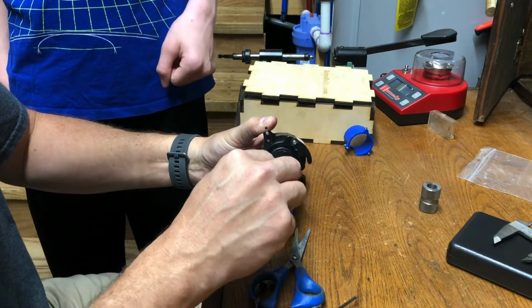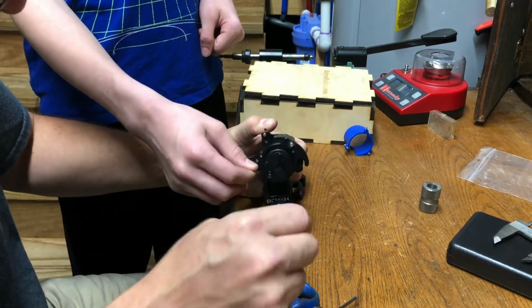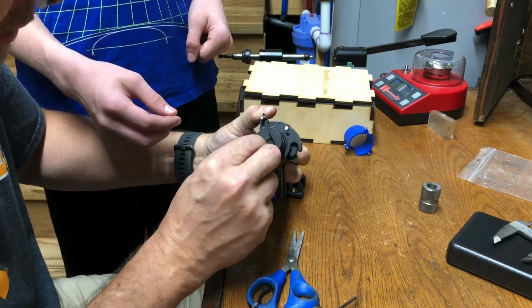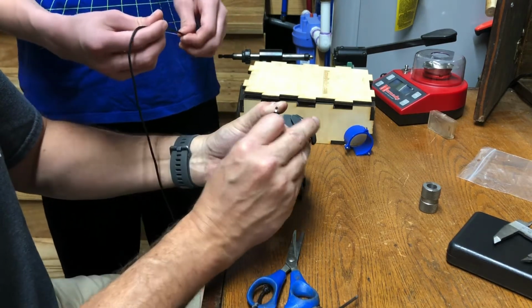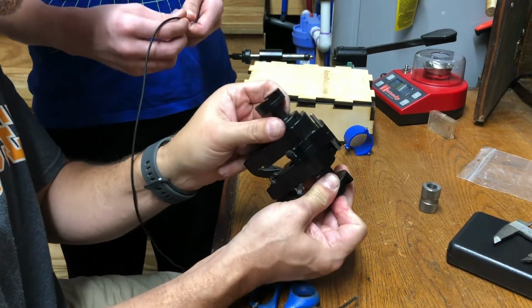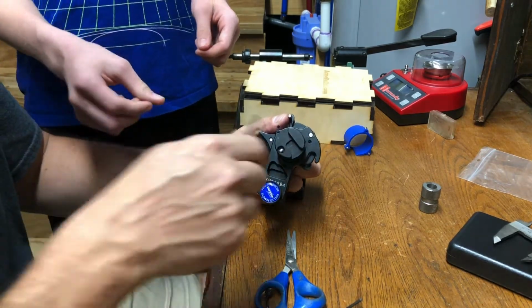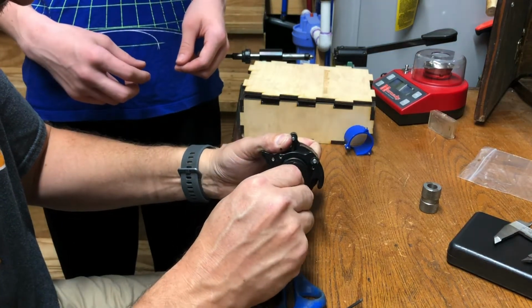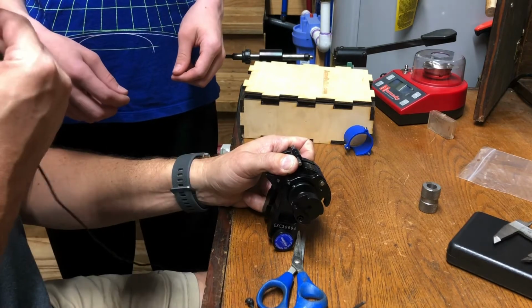I don't know if you noticed when I popped this out, a little plastic bushing came out. I didn't anticipate that. Here you can see me trying to figure out which way it goes. That's not the right way. It actually ends up going in from the inside. I'll figure that out shortly. But it just protects that string from wear on the metal. So I think it's a good part to make sure you have. Don't lose that when you take your string out or your rope out.